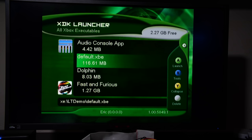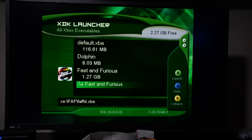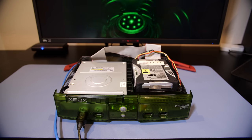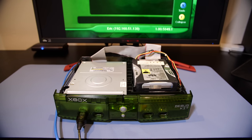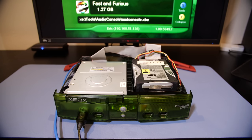There's also an LT demo which is interesting, but I'm not going to run anything right now because any more wear and tear on this hard drive could potentially cause it to fail. These drives have been around since the 2004–2005 timeframe. So the next thing I'm going to do is dump the entire contents of the drive. We turn on the Xbox, connect to the network, and we can see an IP address has been allocated: 192.168.51.138.